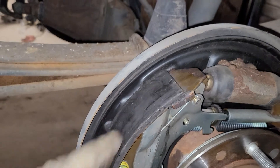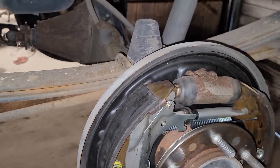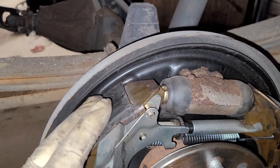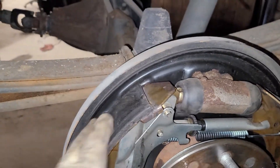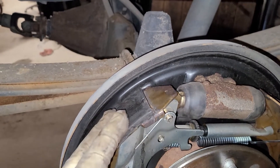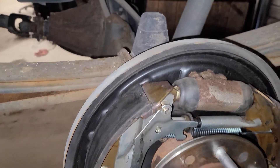What's happening is the gear oil that's saturated into the shoe makes it kind of sticky, and it hangs up inside the drum. As the shoes come out, they catch the drum and get jammed downward because they don't slide like they're supposed to — it gets jammed downward because of the lube that's on them.